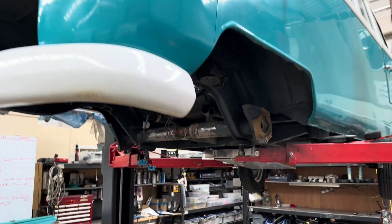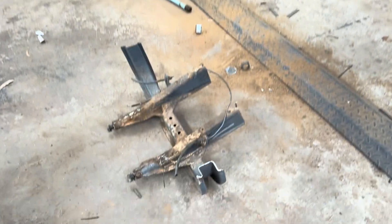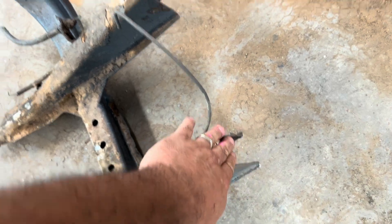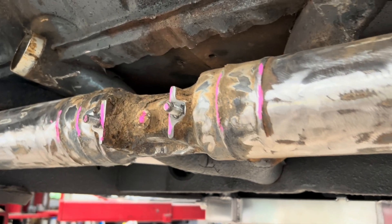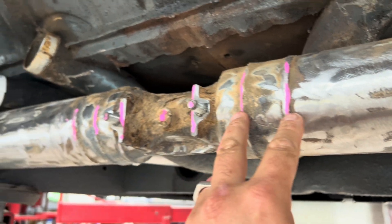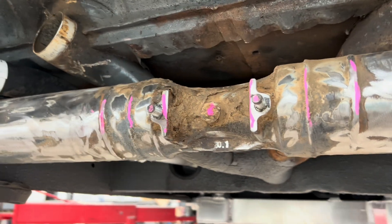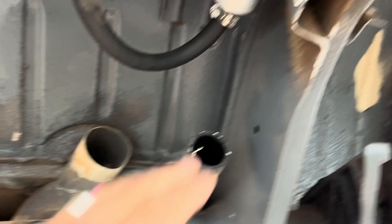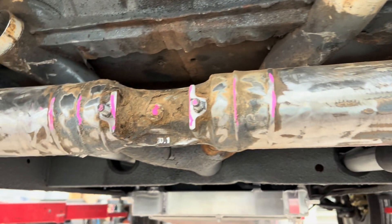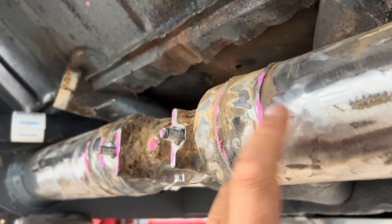So here we're under a split-screen bus. As you can see the frame horns and engine support has all been cut out, which is on the ground there. So where these are cut, I've marked everything pink that needs to be ground down. These two lines where the frame horns and that whole mount system was welded in from factory, and then you'll see where we've cut here as well. All the pink parts need to be ground down flush with the torsion tube.